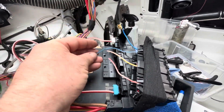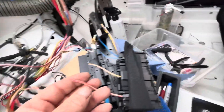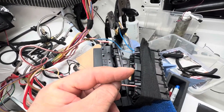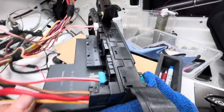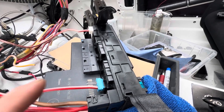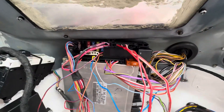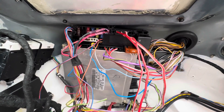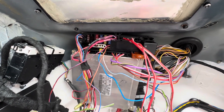So just trying to get rid of this fuse box here. These two wires are for the ignition switch on/off — I'll just put a fuse on that and that's got rid of that. This is permanent 12V and ignition 12V feed, so that means that fuse box can go. There are a couple of permanent 12 volts going in from the main feed behind there. What I'm going to do is get the ignition feed from the ignition into the fuse box and connect it to the 12V feed out, bypassing the K6 relay completely. The PDM will be in its place. I'll keep the little keys box for the ECU which controls ignition, starter, coil, and injectors. I'll power the fan, starter motor, and fuel pump through the PDM when it comes.